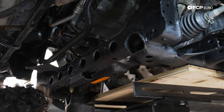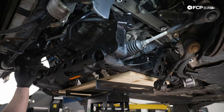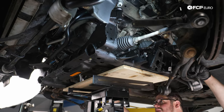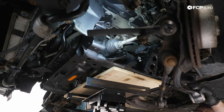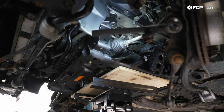All right, now with that, we can continue going up, being mindful of our coolant pipe up front and our power steering line. We'll make sure to tuck those in properly. You want to pay attention to the front dowels on the frame rail. That's where your most forward subframe bolts are going to go in. Let's get our six bolts and get those started by hand, and then we can torque down the subframe and get rid of the transmission jack.